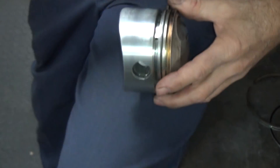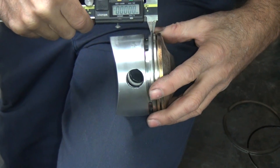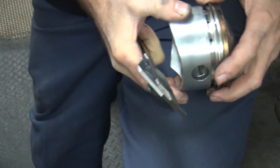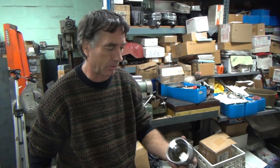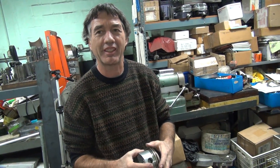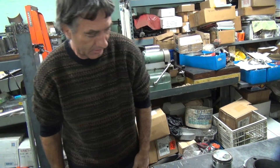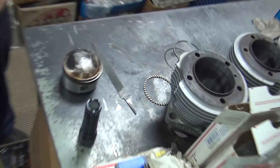See, it was tight on the exhaust side which is over here - this is where I was filing. It's got half of that - gotta work to get the half right there. It's a little snug. With heat, when you heat this up to 400 to 500 degrees, how much you think you're going to lose? Half a thousandth? Hopefully not more than that, because this is not too locked up - it'll be a problem. So we need some rings - I'm pretty sure we're going to be reusing these. I don't think I have any rings today.